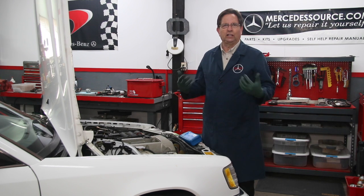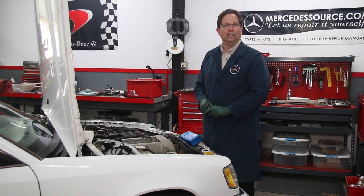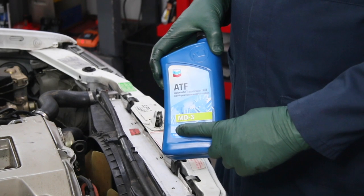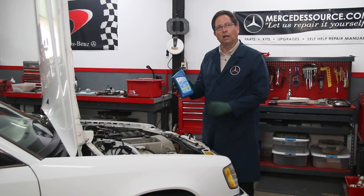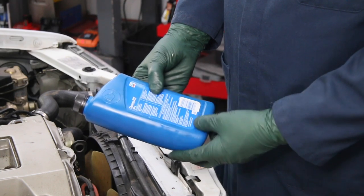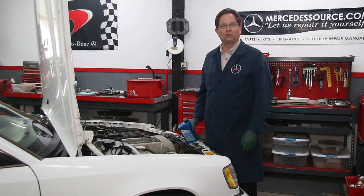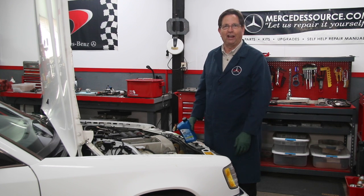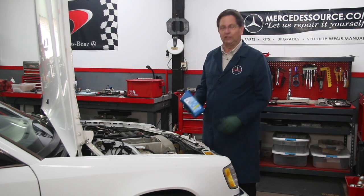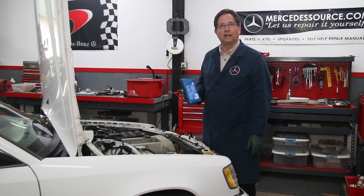I'm not a scientist and I don't have a ton of scientific background, but what I recommend is using Chevron ATF MD-3. If you look closely at the bottle, it says on the back: recommended for automatic transmissions for which former Dexron 3 fluids are specified. I've had a lot of experience with Chevron oils over the past 50 years with automotives, boats, and aircraft, having been an A&P mechanic and a pilot. So when they say this is a good replacement for Dexron 3, this is what I use in my cars and what I recommend.